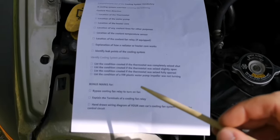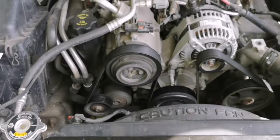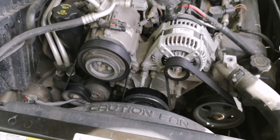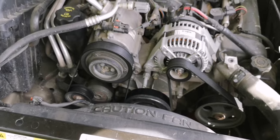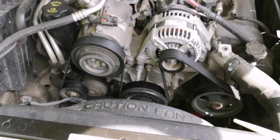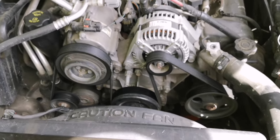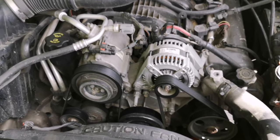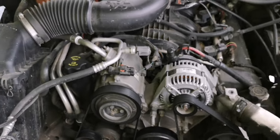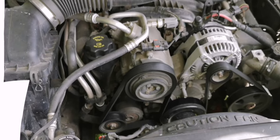What if a Volkswagen plastic impeller pump breaks and stops turning? If the impeller is not turning, there's no centrifugal force in the coolant pump, meaning there's no coolant flow. The engine will develop hot spots on the block, causing severe problems for the pistons and potentially catastrophic engine failure.